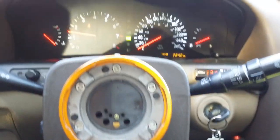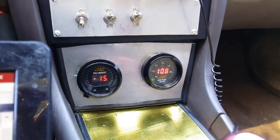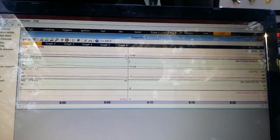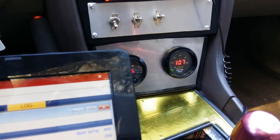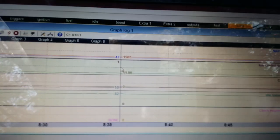She fired right up. There's my stock gauges. I like where that RPM is at. My air-fuel ratio gauge for a cold start is right where it should be at around 11. Going over to that log page will look a lot more interesting now. If I hit play, it'll give us real-time feedback on my motor. If I put my cursor at any point on the screen, it reads the values at that certain point. We have RPM around 1,800 — it's a little off from my actual gauge. Looks like we're getting around the same air-fuel ratios: 10.7, which for a cold start I don't really mind.